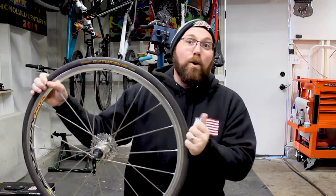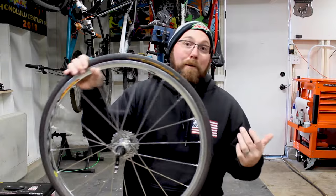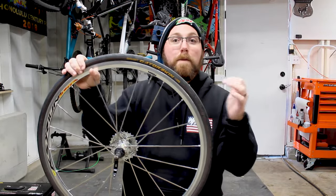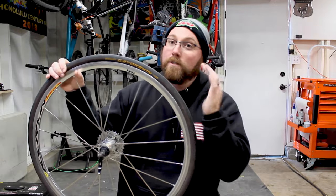For these tires to roll really well for me, I put them up to about 100 PSI — I'm about 250 pounds, so that's about right. That gives me a very solid rolling feel while still having some cushion to it. There are tires out there with much more cushion, especially now that manufacturers have moved to 28 or 32 millimeter widths versus 25.